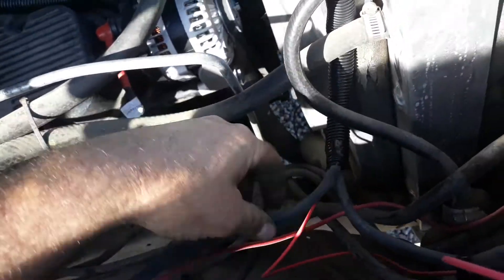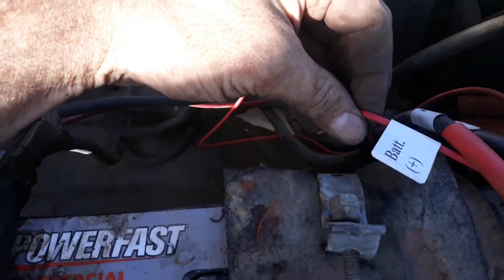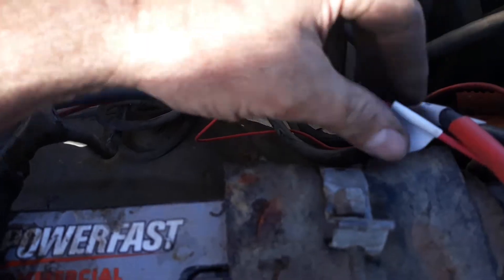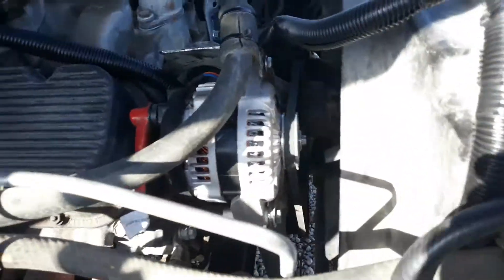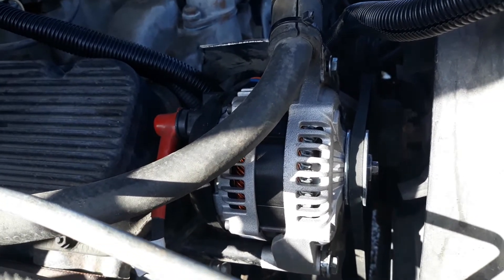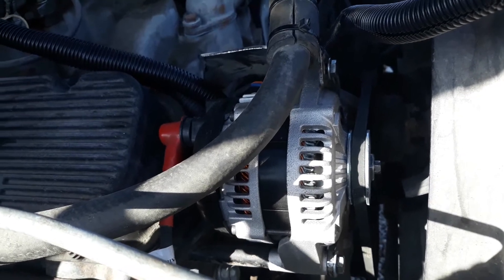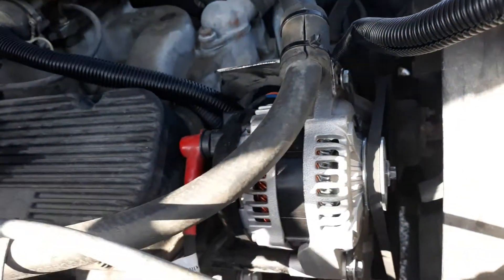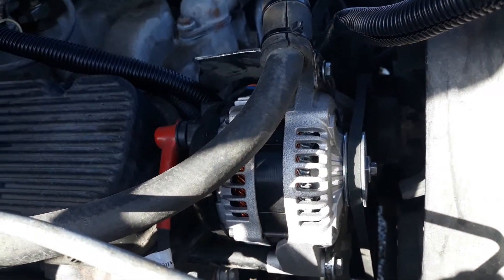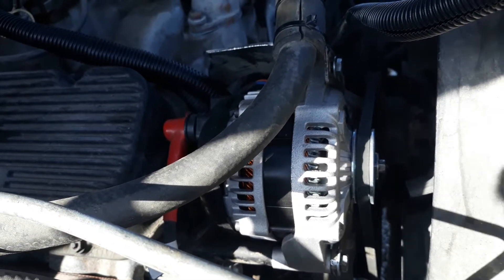These are probably your welding leads — you've got your positive and your negative heavy cable there — and I'm assuming this is your charge wire coming from your alternator. The alternator is 170 amp, 12 diode, I believe. Even a little smaller than the Delco. Fit down in there real nice, actually gives you a little extra room between the head. They run a smaller pulley on them so they can turn more RPMs, and you don't have to run your engine as hard.